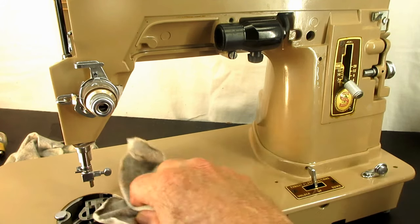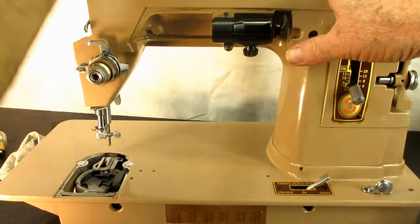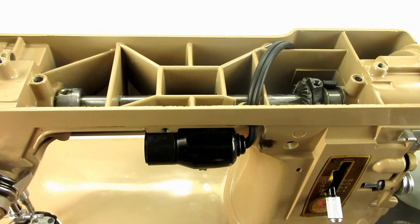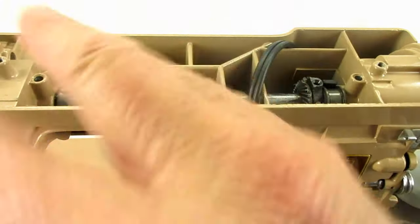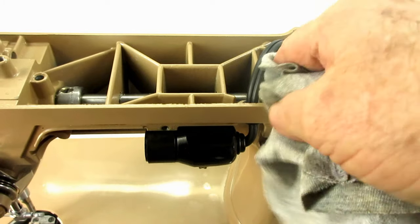All right. Now, many years ago, I read that if you're going to put the machine away and it's not going to be used for months, you want to take your lint brush, that you clean your tension unit with, soak it with oil and brush all the metal parts on the machine. Then when you come back months later and you're going to sew, you take a rag and wipe off all that excess oil, put a little fresh oil on all the normal places, and run the machine 5 minutes.